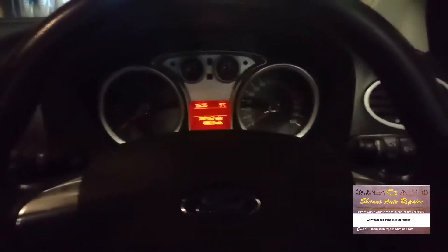We've just brought it in and it's still running at the moment. Looking around, we've got no obvious warning lights on. I've just checked the glove compartment light — that goes off when you shut the glove box, so the glove box is okay. The display stays on with the interior lights on, but what we'll do is get out, lock all the doors, then take some readings from the battery and see where we go from there.